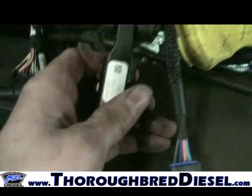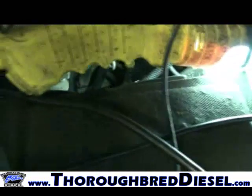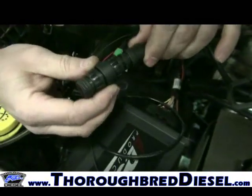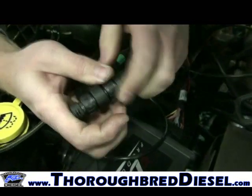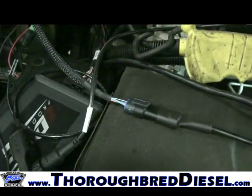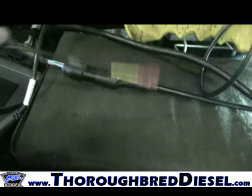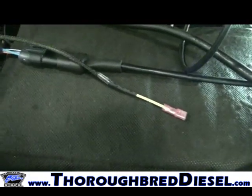The expandable T hooks up to the round side — just push in and the collar comes up and locks it; it screws on and locks. With those two connections, we're finished with the underhood part of the installation. Your turbo timer wire is this single female spade receptacle. This needs to go back into the cab because your turbo timer connection is underneath the steering wheel column.